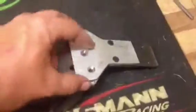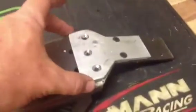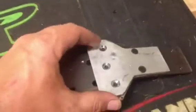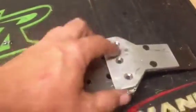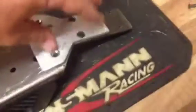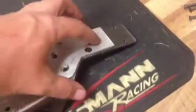Okay, so now I'm on to my build, my super build. First things first, this is a little piece that I made up myself. So all I'm going to do is obviously bolts on there, front bumper fits on there as standard, but I've got to drill 3 holes in the chassis to take these bolts, and that strengthens this area here where they often bend.